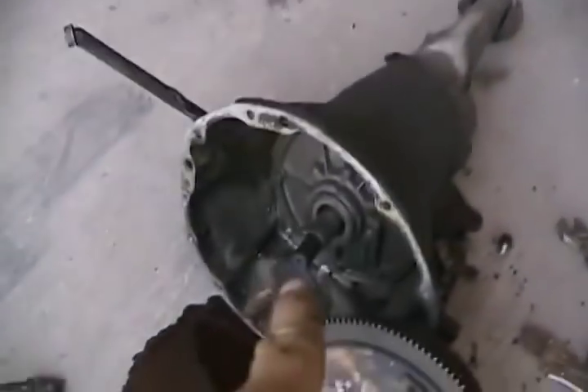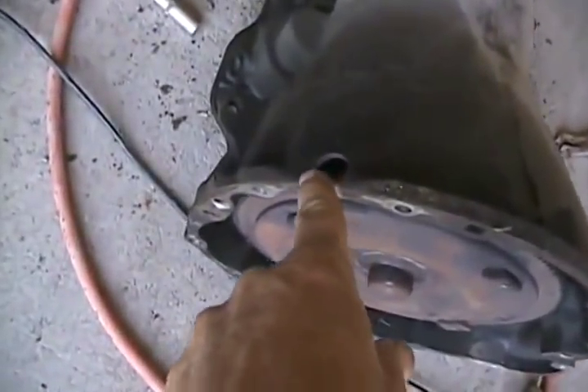It also has a brand new front seal, which is good. So wish me luck. I almost forgot — I have to take the cutting wheel grinder and make a notch just like the one on the other tranny for the crank position sensor. I'll do that right now.